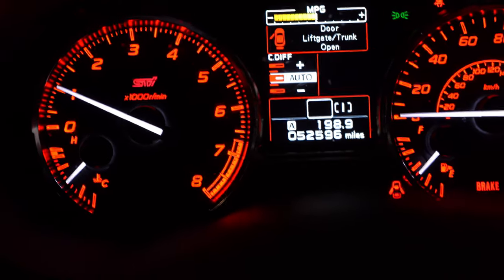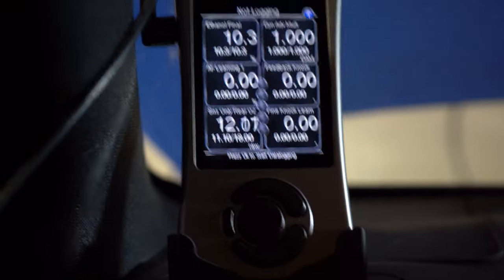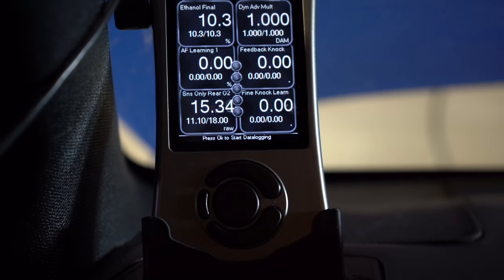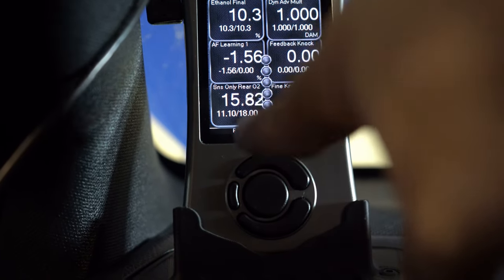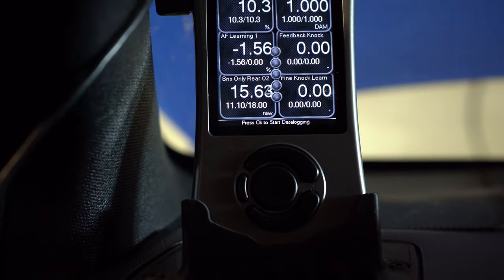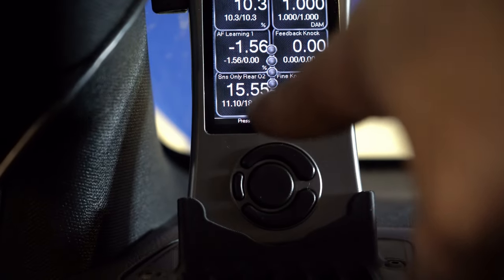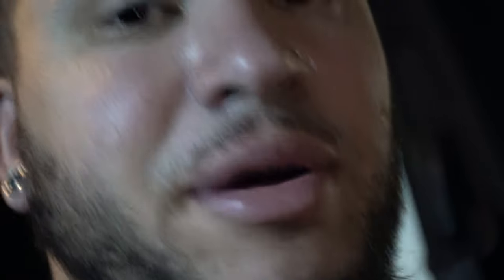We'll start this up, let it learn a little bit, and wait for the AFR to kind of come down. The rear O2 is now the Visconti wideband, so we'll see how this levels out. It's going up — it should be around 14.7. I probably do have to play around with this a bit since it doesn't have a stock intake, it has an aftermarket one, so I do have to adjust a little bit. It seems like it's moving up slowly, so it should be going up. Yeah guys, I hope you enjoyed the video. If you did, please hit the like button, subscribe, and share the video. And I am out, guys.